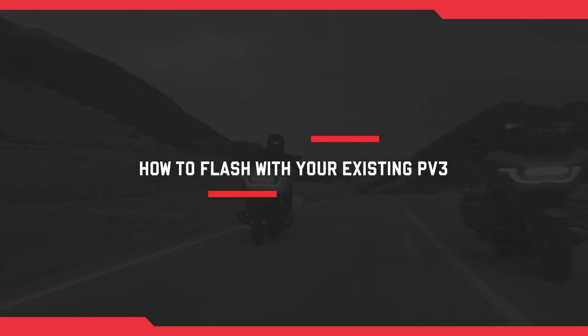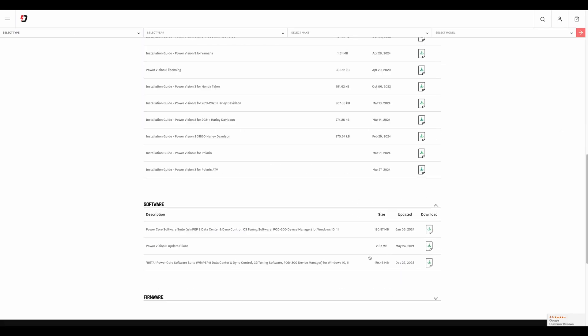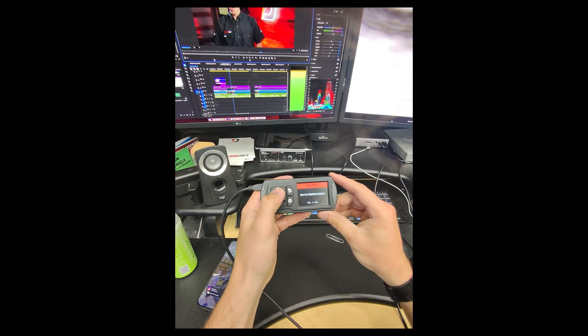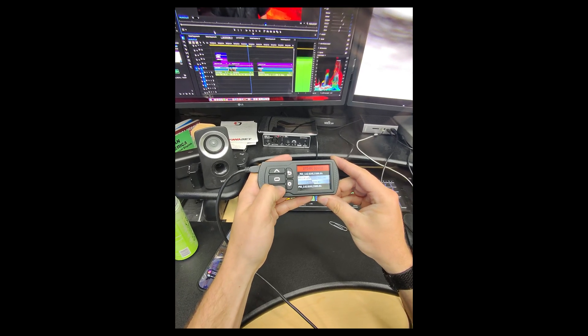For those of you who this isn't a new out-of-the-box PV3 purchased as PV3-15-04, let's walk through how you will upgrade your device to work with these new ECUs. Step one: update the firmware on your device. On our website, click the hamburger menu, jump down to the Support tab, navigate to Downloads and Power Vision 3. You'll see the firmware files — look for the one that says Harley-Davidson, which will be version 3.42, 3.43, or whatever the next version may be as we release more. Download that firmware file and save it directly to your Power Vision 3. Then press the back button, navigate to Device Tools, select Update Device, choose this firmware file, and let it update.